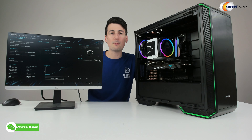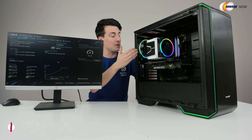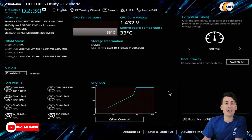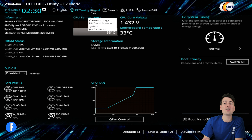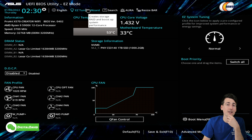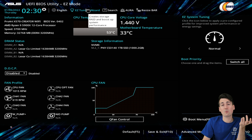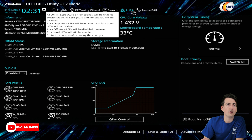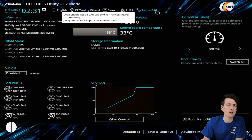Here you go — you can see the PC booted up. We have our BIOS screen loaded. Check out the beautiful RGB fans, and don't forget the really cool RGB we have on the front of the case. Now we're in the BIOS settings for our board — this is the screen you're going to be at, and we're currently in easy mode. You can see at the top we can change the day and time. We have our easy tuning wizard — I did use this and unfortunately it didn't work, and I just got a black screen when it was all done. So I did have to use a screwdriver jumper and reset the CMOS battery, and those settings cleared and it worked again. So proceed at your own risk. We have a search option and LED RGB controls right here, and we can also resize the bar depending on your GPU.